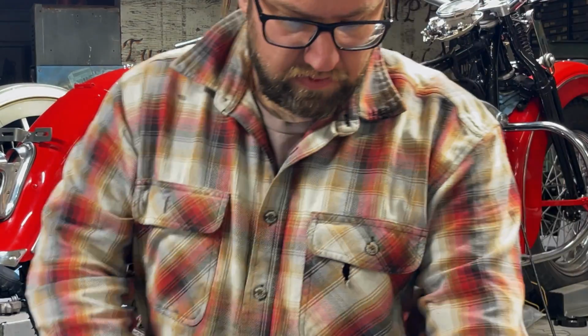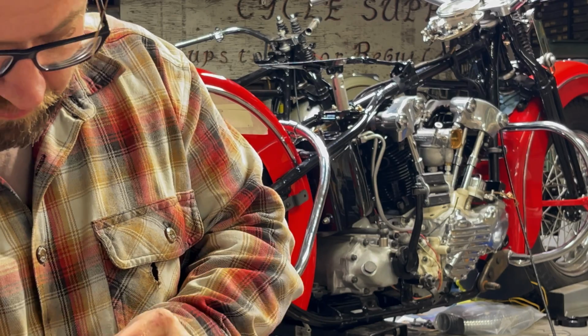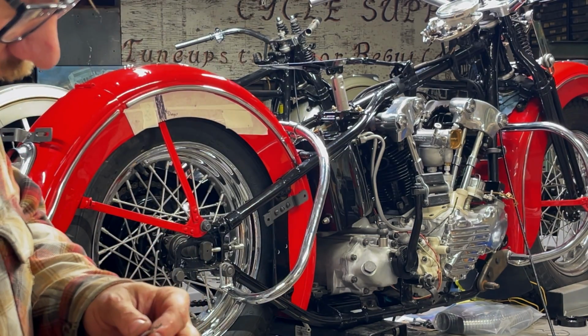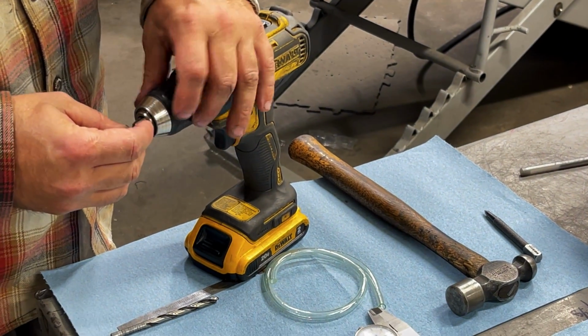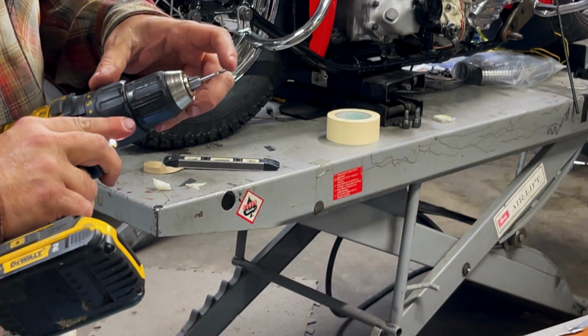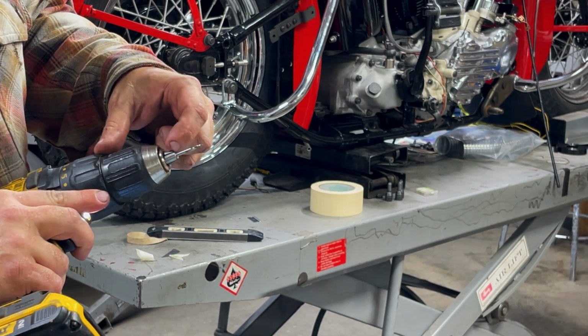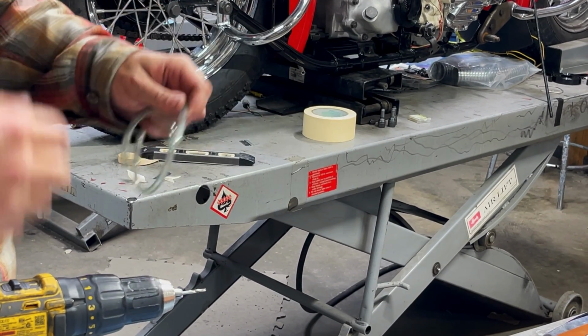Okay. Next step is to drill our 1/8" holes. This is a double-ended 1/8" drill bit, and they're really robust and tough. I love using them. Because they're so short, once it goes through, you run the risk of kissing the fender skirt with this part. It's covered up by the saddlebag plate, but you still don't really want to do it.